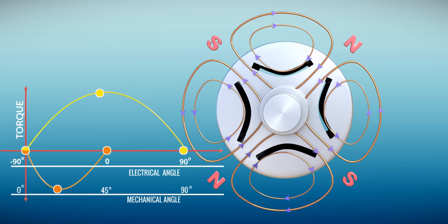As the motor speed increases, the permanent magnets induce a back EMF on the stator coils. To overcome this issue, Tesla Motors engineered a simple solution for high-speed turning: the RMF weakens or almost cancels the permanent magnet field. This way, even at high speeds, such motors won't produce much back EMF. Obviously, at this stage, the torque production will mostly come from the reluctance effect.